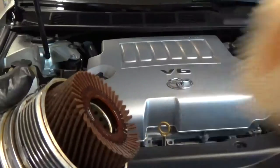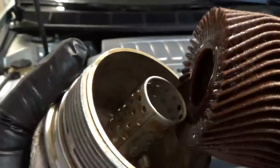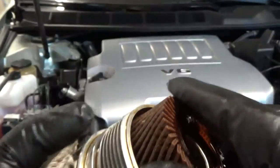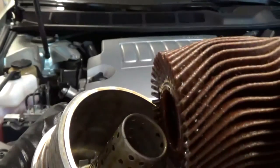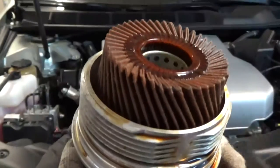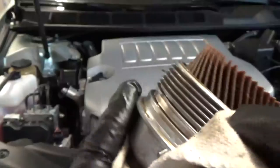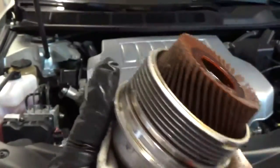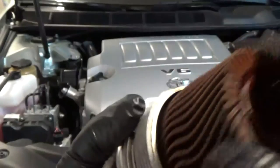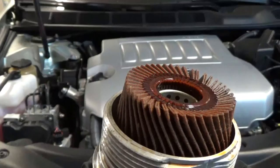The new one versus the old one — twisted, crumpled. So you do want to change them. Even if you just change the filter on a car that drives maybe 1,000–2,000 miles a year, you could change the filter every year and the oil every other year — that's probably acceptable. But the main thing is change the oil, and even more important, change the oil filter.